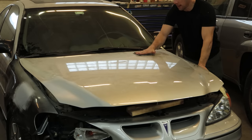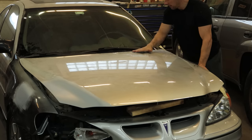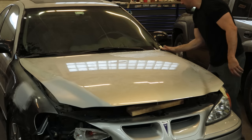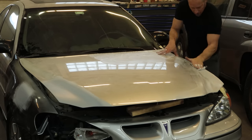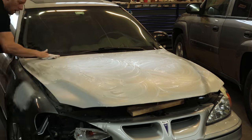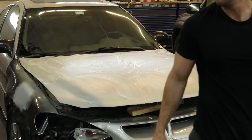I have a little extra time so I'll get it ready for the painting. Even though I hate sanding, I can manage this — it's just like gritty toothpaste and it goes pretty quick. We're using a gray scuff pad with the sanding paste. It puts about 1200-grit scratches in there so we're able to clear right over that. We're going to sand it all down and give the clear something to stick to, and then sand the primer with 600 grit. Because it's a silver car, 600 grit is about the coarsest you want to go so you don't see scratches.